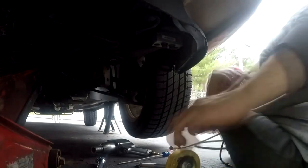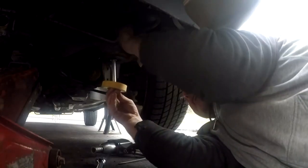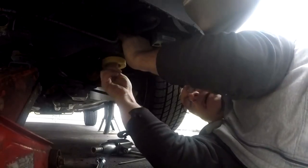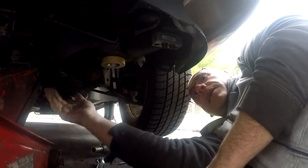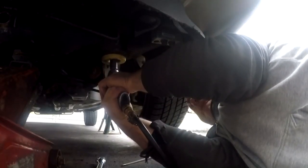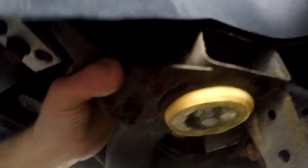I'm gonna load it right up. I don't want these bolts to seize up in the nuts, because if that nut starts spinning up in there you're screwed — you can't get to it. You'd have to blow a hole in the frame to get to that stupid nut. So now we're just going to line everything up, start it by hand, then zap it with the gun and it's gonna bring the whole frame back up in place. This one was pretty easy in the front. Alright — new bushing, new bolt — let's go attempt the rear.